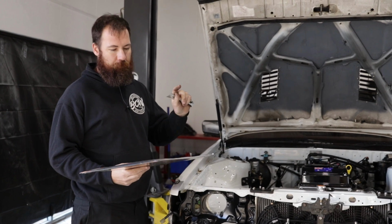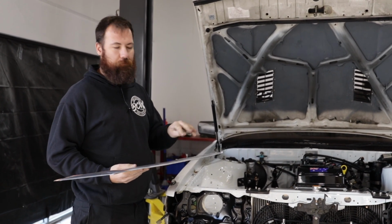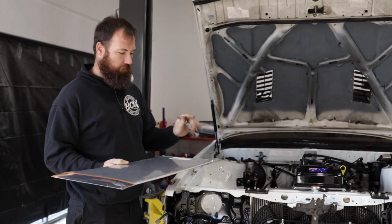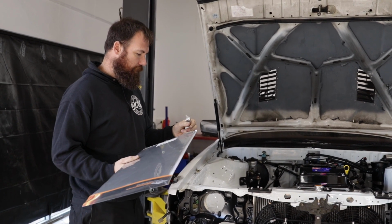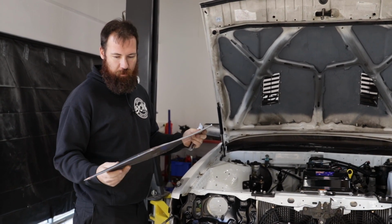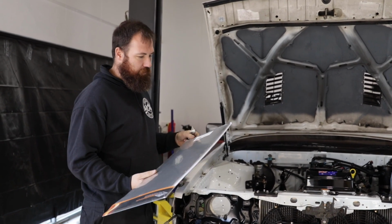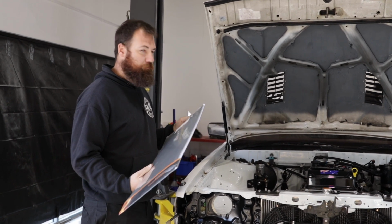Also a good rule of thumb, if you can fold the cardboard in a place, you'll be able to fold the heat shielding in the same place. So it's good to work around complex curves and stuff. It's pretty easy to bend. They gave us a little quick demo when we were speaking to those guys at MotorX. So it's a really good product, and we're keen to get using it in our car. So we'll unpack it and start playing cardboard heat shields.